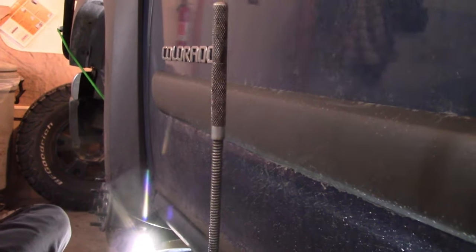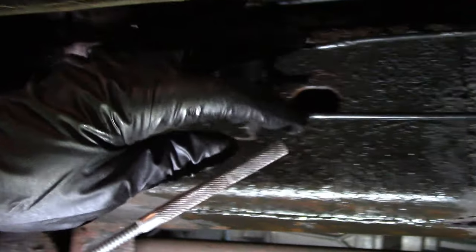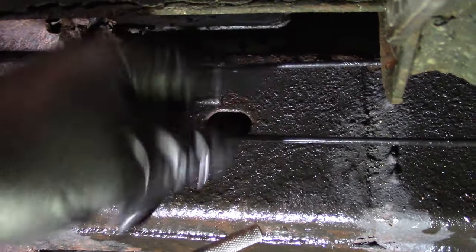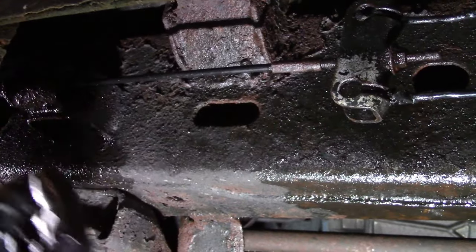Now let's find the parking brake cable equalizer. It is below the door handle of the driver's door. If you follow my pointer down here, it's pretty much in the middle of your driver's side door. Right here is your parking brake equalizer. The first cable comes down here and ends there, and then the two cables here go to your two rear wheels' parking brakes, right? So if you get down here, we've depressed the pedal, but it doesn't return.